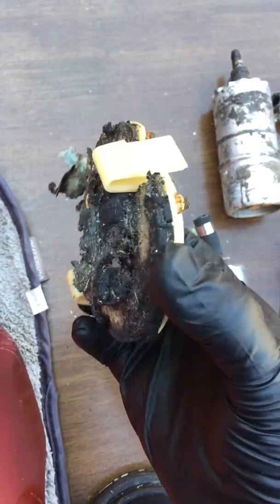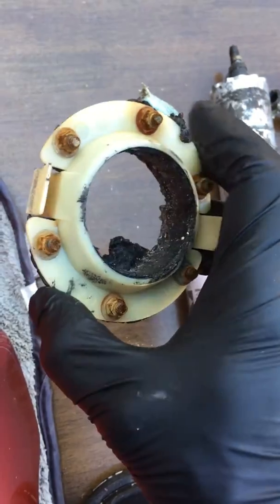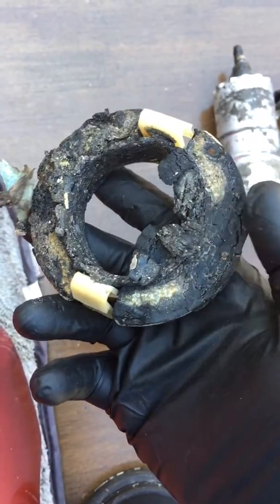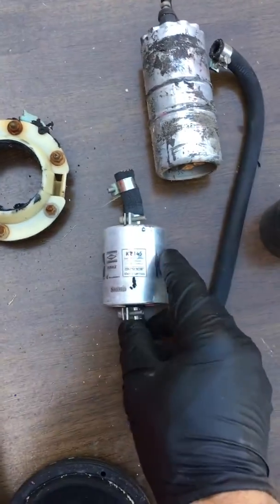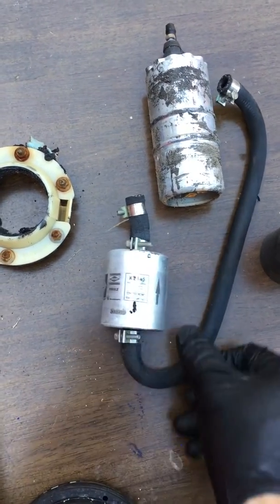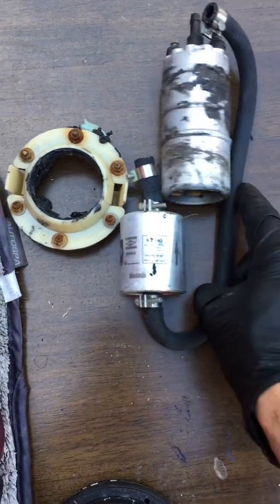Clean your fuel tank thoroughly and remove these screws. We're going to keep this plastic housing but remove the old rotted vibration damper. Here's the factory fuel pump, the factory Molly fuel filter, and the fuel line — those are all going to be replaced.